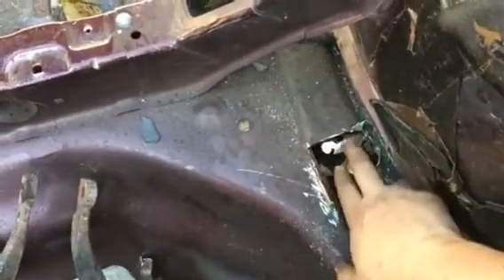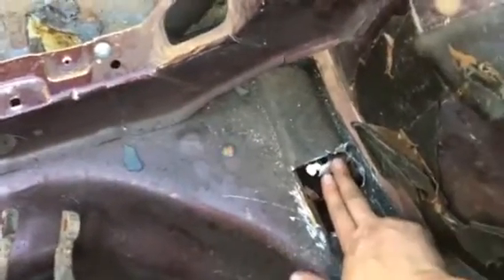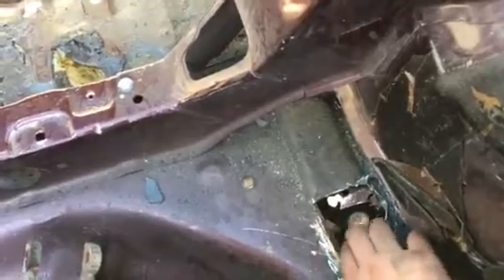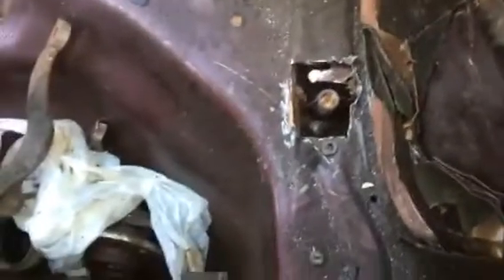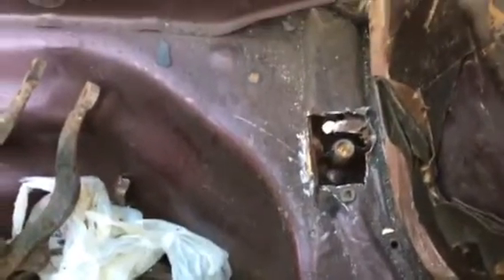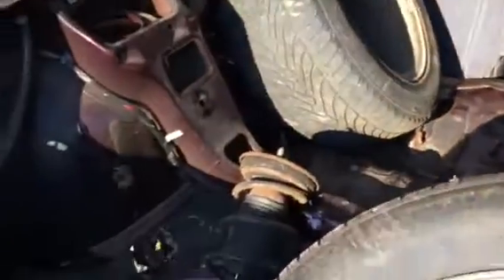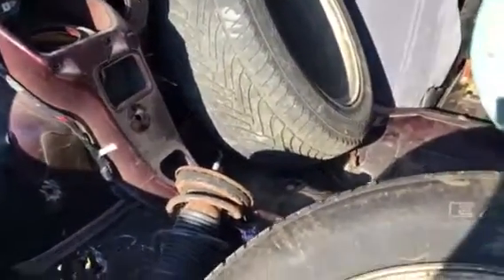The next tool was the cutoff wheel. The cutoff wheel's limitation, and a lot of the bending and twisting you're seeing here, is from using a pry bar when I'm done to pry that top piece off the tube. There's a bracket that gets welded onto here, so when you cut there's still a big thick piece of bracket. You've got to cut it and try to pry it off and move it back and forth enough to pull the bolt out. The cutoff wheel made a smaller cut and that was easier to work with. I was being a lot less cautious near the end mainly because I just wanted to be done — it's getting pretty hot. All together it's not too hard to get the bolts out.